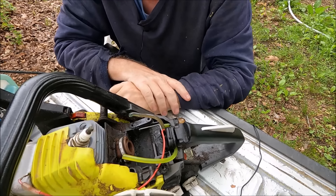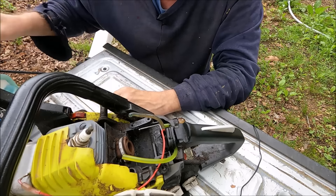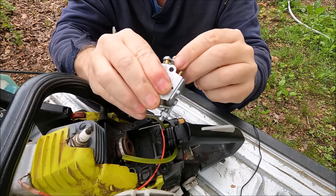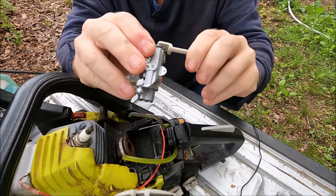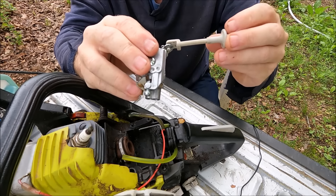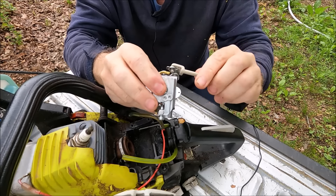I have a whole bag of hoses that I bought a few years ago when I was repairing that old chainsaw — all the hoses in it got real brittle and were breaking off. I replaced this hose, hooked it all back together, and it started and stayed running as long as I had the choke out. The choke is this right here — you pull it out. So that's the choke, and then you hit the accelerator and it pops back in.